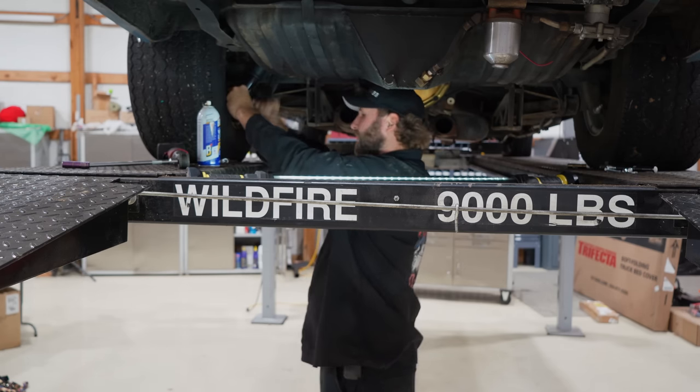And if you didn't know, it's coarse thread on one end and fine thread on the other. So instead of drilling and tapping that, it's already wallered out. I want to try to keep it the same size. So I'm just gonna finish taking the threads out with a drill bit over here, and then I'm just gonna run a 24 thread bolt all the way through and nut it on the backside. And that way it's all the same hardware all the way around this thing in case we gotta pull it off, make any adjustments, stuff like that. All right, easy but faster, but also take it easy. Ooh, I should have put some tape over that. Nothing in there, we're good.